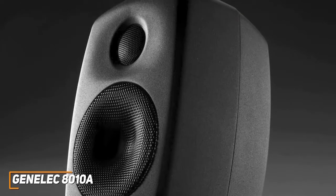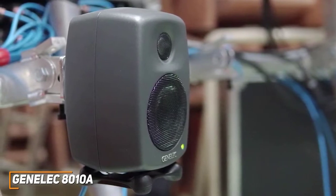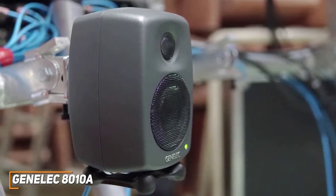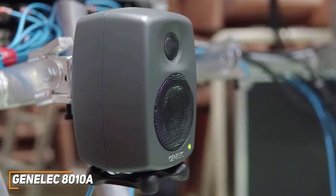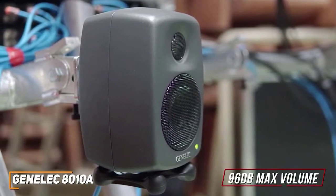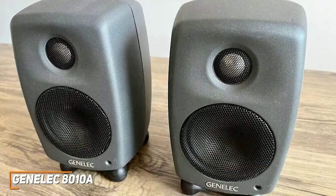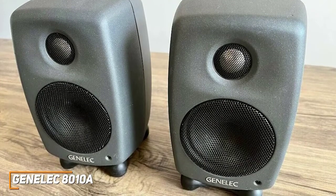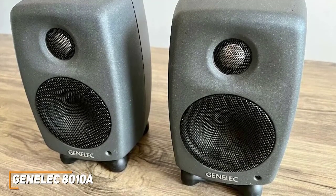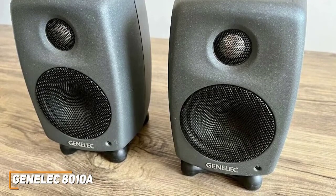input is detected. On the inside, the speaker utilizes a near-field system with a 3-inch subwoofer, 2-way drivers, a 3/4-inch tweeter for higher frequencies, and 2 Class D power amplifiers to produce a maximum volume of 96 decibels, which is ideal for smaller mixing spaces. Overall, the sound remains clear at higher volumes, and it delivers balanced, accurate audio with treble that doesn't sound harsh, warm mids for better depth perception when adding effects, and a powerful bass response.